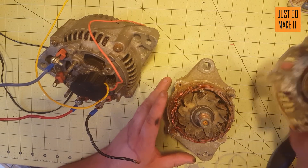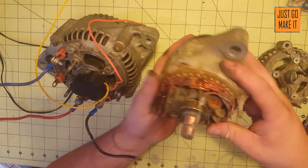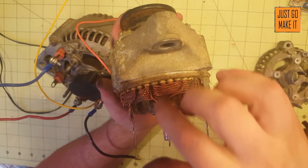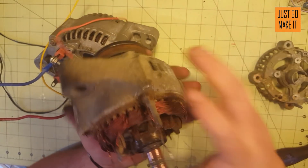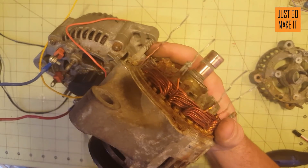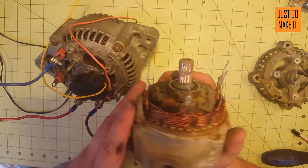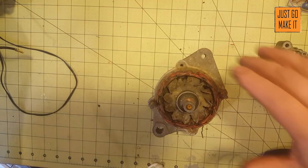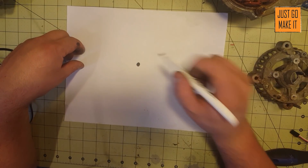Some alternators you don't have to pull your backside off, but it's a handy thing to do to identify your wiring connections. I have four wires sticking up on this one. You'll notice this one connection right here has three wires all running into one connection, and the rest of them are just one wire. This connection right here is called your center tap.